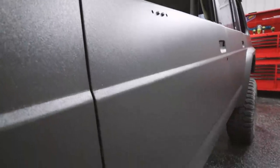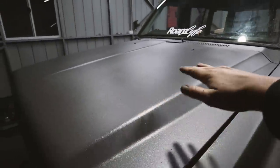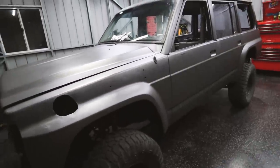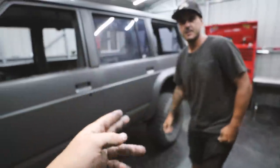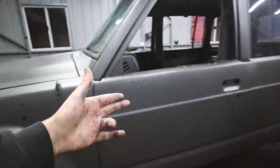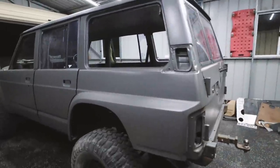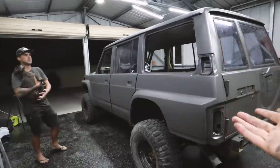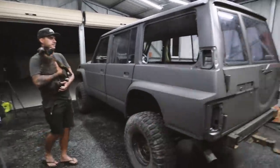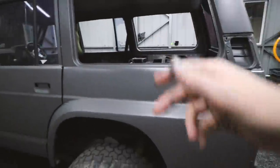The paint turned out insane. Very happy with the texture and how even it is — this is tenfold better than my car. I was in there tweaking it, getting the pressure right, and nailing straight even beads. The color isn't much of a change visually, but Harry and I always liked the graphite from Toyota even before we had Patrols, so it's something we always wanted. For anyone wondering the settings: 2.4 tip, thinned 10%, 40 psi, shot from about 30 centimeters away.